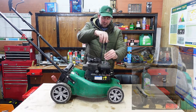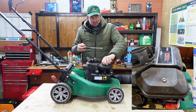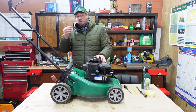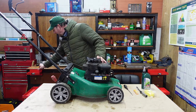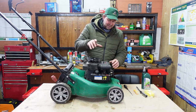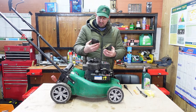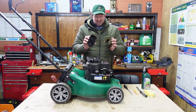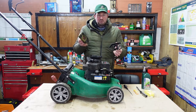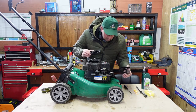We'll take this air filter cover off — and I always remember it's lefty loosey righty tighty, so it's easy to undo anti-clockwise. There's a long thread on there. I have these little magnetic trays around; if I put the parts in there, they don't fall off the wrench and roll around. So we'll take this air filter off — it's come off in one block, not just the lid. It's a bit dirty — blimey. It seems to be soaked in oil, fuel, whatever's in there.